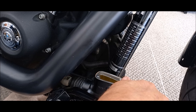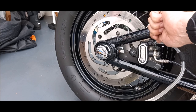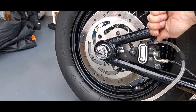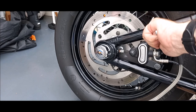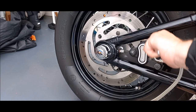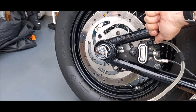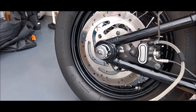Whatever you do, once the brake pedal goes all the way down you have to shut the valve off. Don't release it while it's open or it will suck back the old stuff plus air bubbles. So: pressure on the brake, crack the valve, brake goes all the way down, shut it, release the brake. Pressure, crack it again, shut it, release. You can see the fluid coming through.